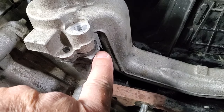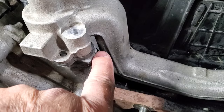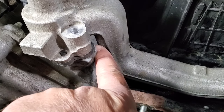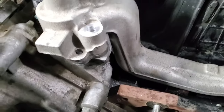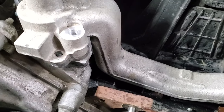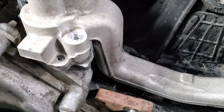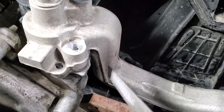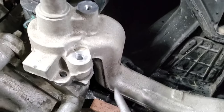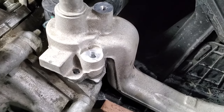You may say, hey, this one looks a little bit different than mine. Yours will actually be a 90-degree casting in the head. That 90-degree casting is nothing more than just a flange under here. I'm trying to slide this thing out and it's so darn close — if I could remove an eighth of an inch, I could probably get this thing to slide out. Well, guess what? Here comes my file. I went in here and I just started filing that guy. I could just barely get enough room in there.